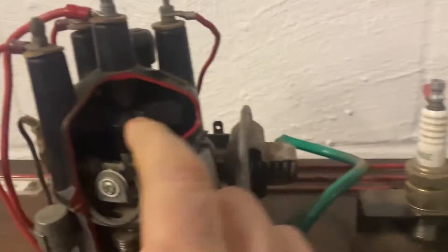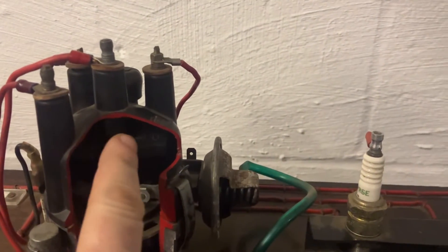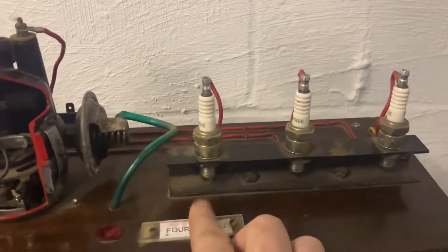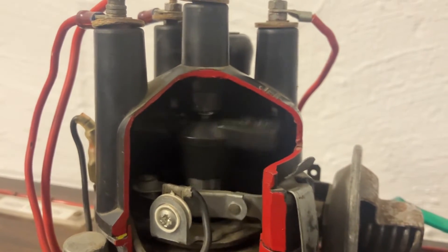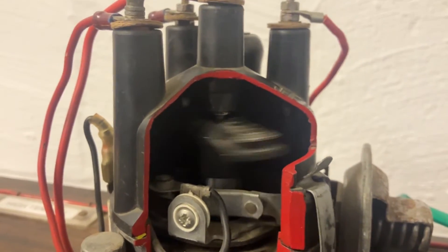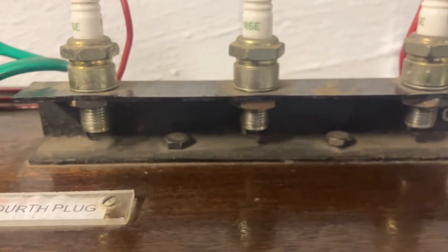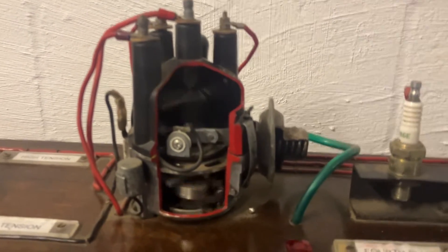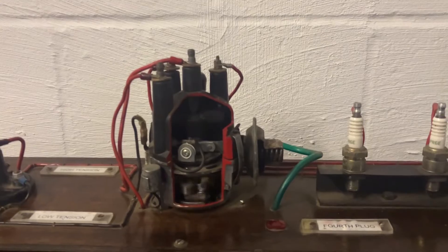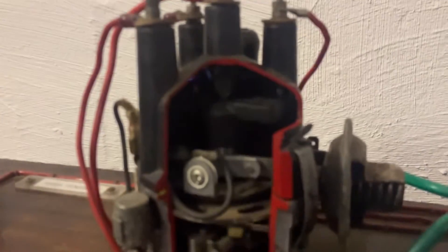So I'll turn on the power and we'll see this rotary arm spinning around in the housing, hitting those contacts and delivering a spark, which will jump across, run down the high tension leads all the way to the spark plug. Let's turn it on. You can see it's arcing onto the casing because there is one contact missing, but you can see the rotor spinning around, taking the high voltage, touching each contact, and sending the electricity down to the spark plug — which would then fire and burn the fuel-air mixture in the cylinder. As I said, with the increase in RPM the mechanical advance would twist that distributor slightly earlier so it fires slightly earlier and you get the perfect burn. Hopefully that makes sense — see you in the next one.